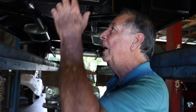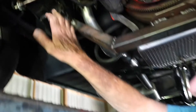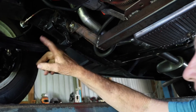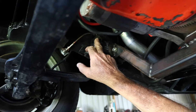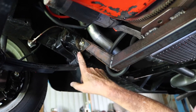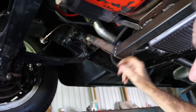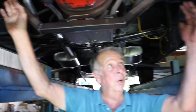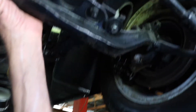Going back here — I had to build these boxes because the Chevrolet pickup truck axle was narrower than this car's frame. I had to build these boxes to put the springs where they would fit — I couldn't go any further that way with the spring. So I put this in here and then built this as a brace to hold the front end apart. The straight axle will hold it apart in here.